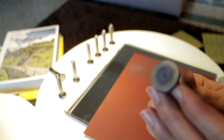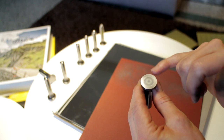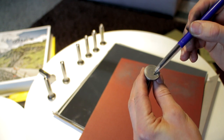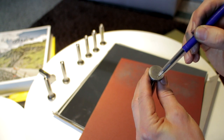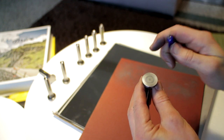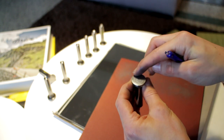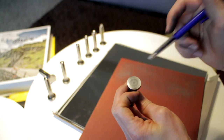I'm continuing sanding and you can see a difference — it has become a little bit less deep, a little bit shallower. You can still see a shine of the blue, but between here and here there's a circle that's quite a bit shinier than the edges — that's because this is still a little bit deeper. This is the contact surface on the cam lobe because the lifters are not directly on the lobe but a little bit next to it, so it catches on one point and completely turns the lifter with every revolution. Continuing until we can see the circle disappearing.